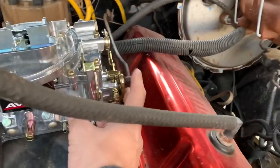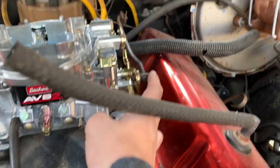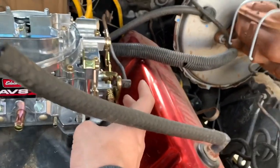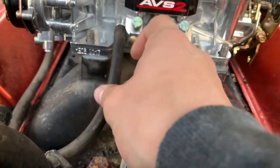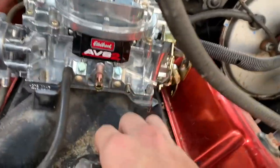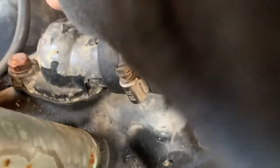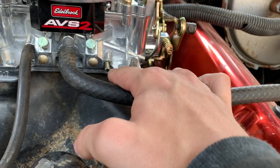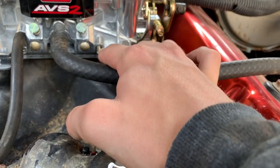I'm going to take some time to explain these vacuum lines. Luckily the linkage fits perfectly — we were afraid it was going to be too short or too long, but it fits great. First, this vacuum line here goes to the distributor — it's the vacuum advance, which helps spin the distributor and gives you a little better throttle response. This one here is for your PCV valve — ours is just a little bit too short. Oh, maybe not — got it! PCV valve is now connected.